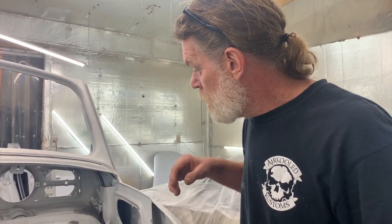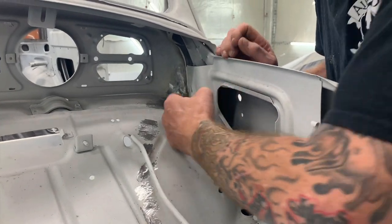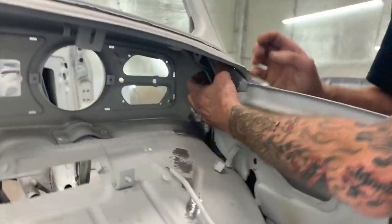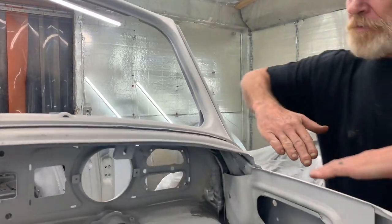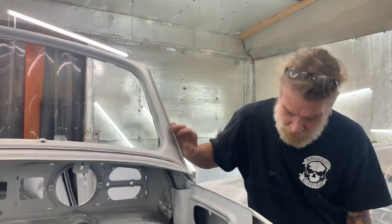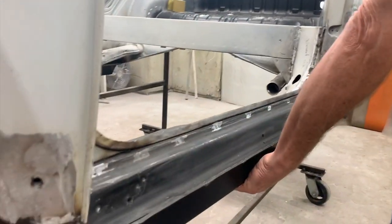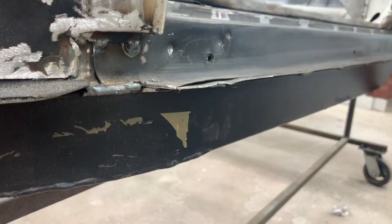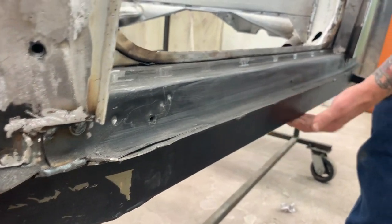So on the earlier convertibles, they're different engineering and different things. This is a '67. So in here we've got extra support rails going here. They come up into here, and they actually come up into here. So it keeps this part of the body from flexing. And then underneath the standard rails here is another support rail. So this runs the entire length of the body — it also keeps it from flexing. That's not on a standard.